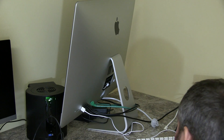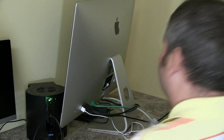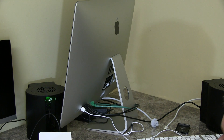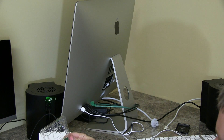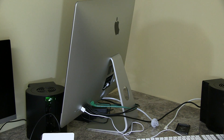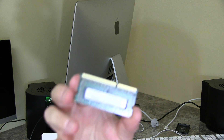In my case, I noticed there are two memory modules in there currently. In the two other slots that are not occupied, I'm going to install the new memory. First thing you want to do is tap your desk — make sure you discharge any potential static electricity that may be inside you, because that can kill memory and other electronics as well. When you pull your first DIMM out — a DIMM being a stick of memory — and be gentle removing it from the packaging, you're going to notice there's a groove, and it's not perfectly in the middle.